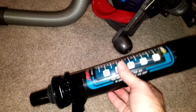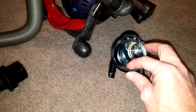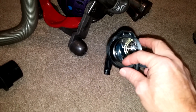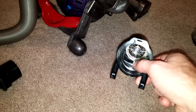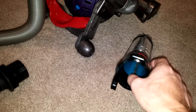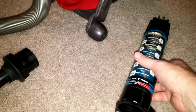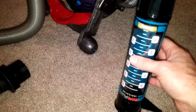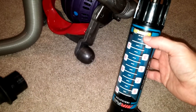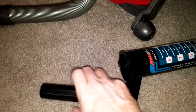Provided this isn't abused, dropped, or thrown around — and because this passes a lot of airflow through it, the inside of the tube will get dirty, especially if you're in a dirty environment. So what do you do? You can take a paper towel or a rag, put Armor All on it, wrap it around in here, push it through, twist it around a bunch. I find I have to do that about once a year to keep the inside slippery. As Miko found out a couple of months ago, his disc was getting stuck — it would go along, go along, then kind of get stuck somewhere in here. This is a sensitive device and it does need to be maintained and kept clean.